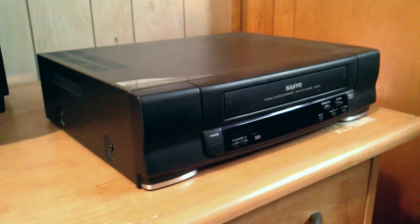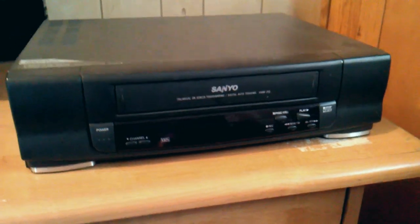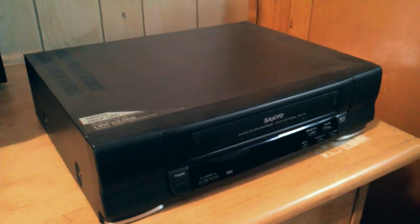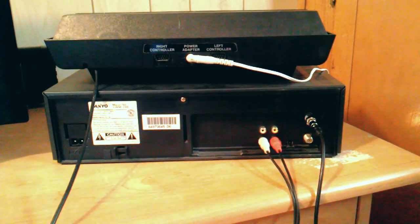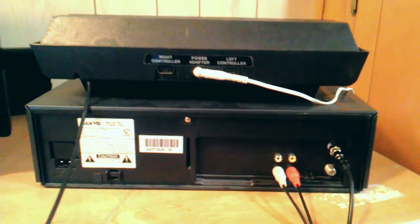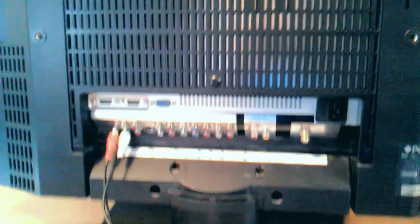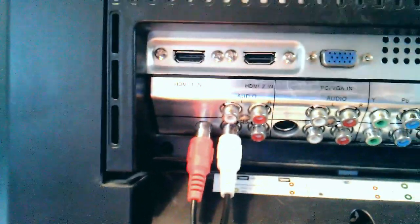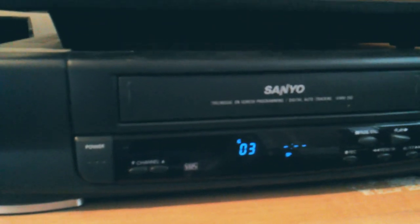Now if that didn't work or you don't have the correct input, you're going to need a VCR. You can get these for pretty cheap, anywhere from like $10 to $30 — I got mine for $15 at a thrift store. Setup is pretty easy: just twist the RCA cable plus adapter into the cable/TV in, then take some RCA cables to the RCA out and plug it into the appropriate input on the back of your TV. The color of the RCA cable doesn't matter. On the TV side, make sure you switch it to whatever input you plugged it into, and make sure your VCR is on and set to channel 3 or 4, whatever your Atari is set to. Then turn it on.